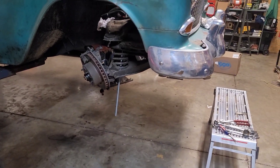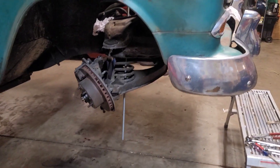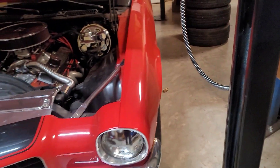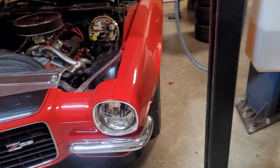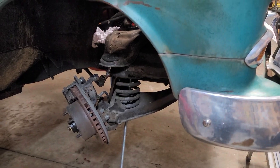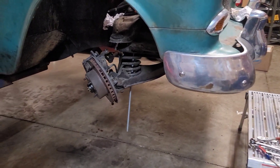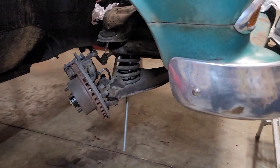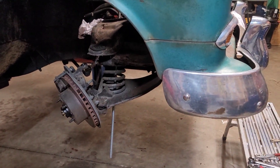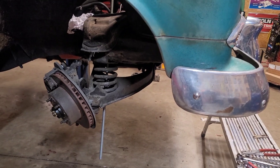Welcome back to SNM's Tri-Five Garage. Yeah, these are going to be a series — one continuous video once I'm done. Less than an hour and this side is about to be dropped. That's my little homemade spring compressor — we've been using it for years, ain't no sense changing it, it works, it gets the job done. Now it's time to lower the spring, the control arm, and the spindle all in one — that way I don't have to break that apart. So now it's time to take the four bolts and nuts off the control arm and lower it all down as one.